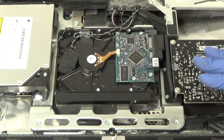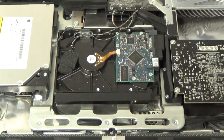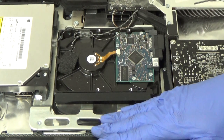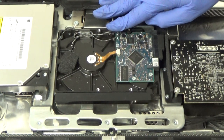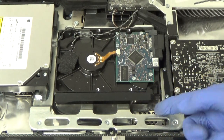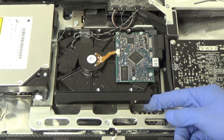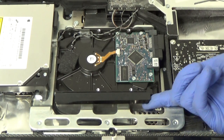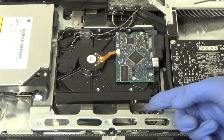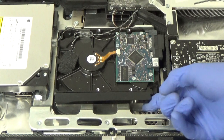All right, so if you're working on the iMac, when I was zoomed out, you could see how it was. The foot is away from you, so the top is towards you. So this is the top of the iMac down here, and this is the bottom. So look for the bar, it should be towards you. What we want to do is grab what will be your right side, or the left side of the actual iMac, and you can feel a little ridge on the underneath side, on the underside of it. So what we want to do is kind of pull that out a little bit and then up, and it should unlatch